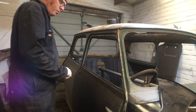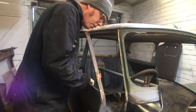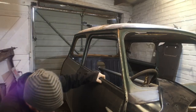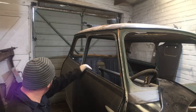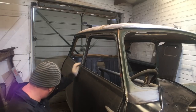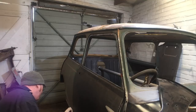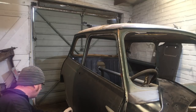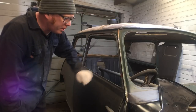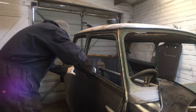I only need sort of four or five mil to just leave the gap. So what I'm actually thinking of doing is chopping the door frame down here and then lowering it by three or four mil, which will give me the clearance I need at the top. Checking the glass — the glass is exactly the same height on both front and back panes. So if it fitted in the back, it should sit in the front. I'm not too sure why it could be higher. Before I do that, I'll just do a few more double takes because it does fit nice. I just think I need to drop it four or five mil — five mil at the max. That'll go in. I think I'm going to go with that.